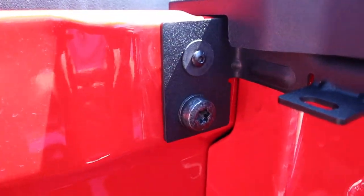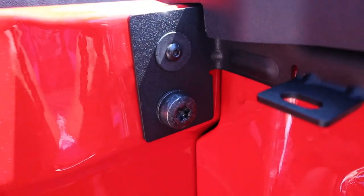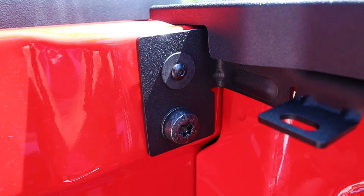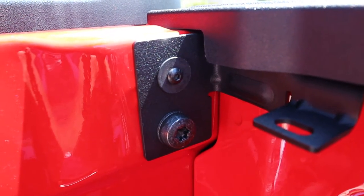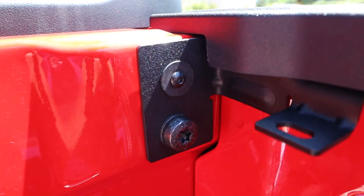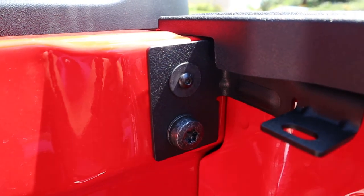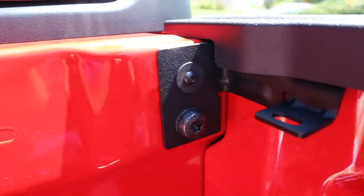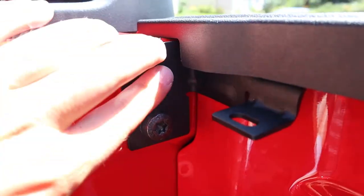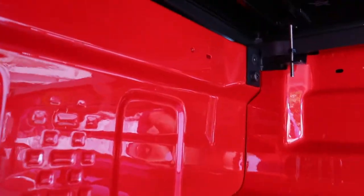First bracket is in place. The bottom bolt is a T50, the top one is a metric size 3 allen bolt going into an expansion nut. Basically twist the allen bolt into the expansion nut a good amount so it starts to expand, put it in the hole, tighten the bottom bolt all the way while pushing it up under the bed cap, then tighten the expansion nut on top until it's snug. Now moving on to the other side — you can see those are threaded through the holes of the bracket.